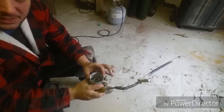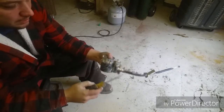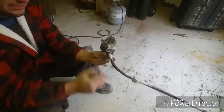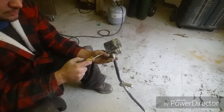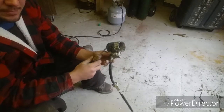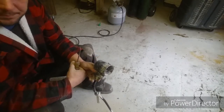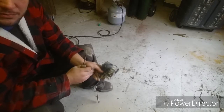There's actually a relocation kit. What it does is it keeps a valve similar to stock location, so you run up and then this thing kind of runs up a little bit over the gas tank. This was previously on the back end of the gas tank. And then it's got another hose — just a soft rubber hose — that goes from the new valve assembly up with a little grated filter deal at the top of it. It runs up underneath the cab of the pickup, and that helps keep some of the dust down. It goes up on top of a frame rail — it's just a lot better spot for it.